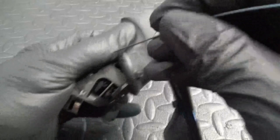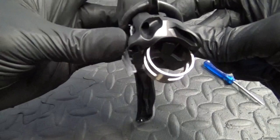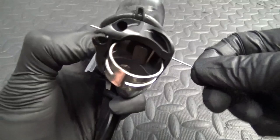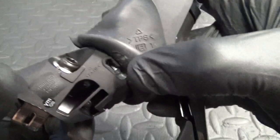You want to put the cable through the top slot, then push it through the body so it goes through and out the other side. You might have to push the hood out of the way on this side as well to get the cable to pass through. Once it starts to go through, just keep going. Pull it all the way through until you get to the stop on the end. Then push the stop down into the bottom slot, pull on the cable the other side, and it disappears up inside.